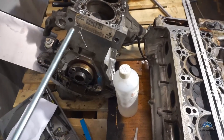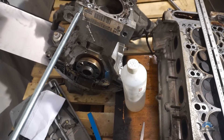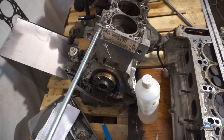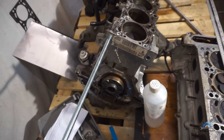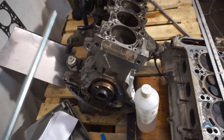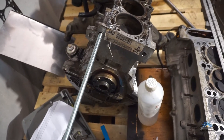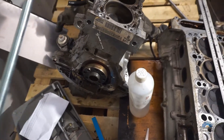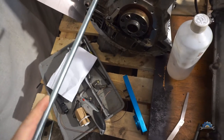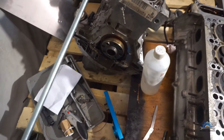Welcome guys. Today, another day — before I discovered this head gasket issue, the cylinder head is not great. The seller told me to refund me half of the price I paid for this engine, so not bad. I got a spare head. Today I'm going to try to put this block on the stand, that's why I bought these new M12 rods. You need about four pieces — one here, one here, one there — and secure it with nuts, then install the bracket.